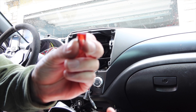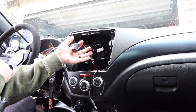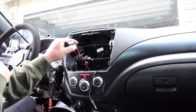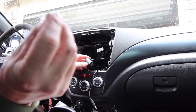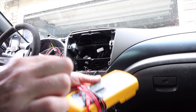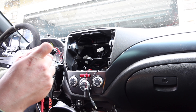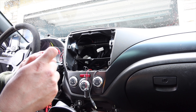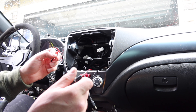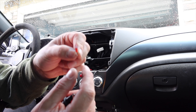It's been a bit of a hard-fought battle but I think we may have found our problem. I managed to rip the whole stereo out and figure out what I was doing. When I was younger I did a terrible job running these wires — they're way too thin for the amperage that's going through them. All of it has been stopped by this blown fuse. Let's test it for continuity — and it doesn't have any, so the fuse is blown. We'll replace the fuse, but there's a reason it blew, so let's figure out why.